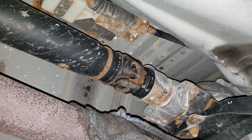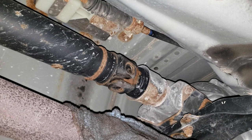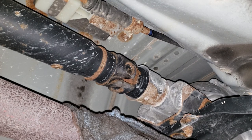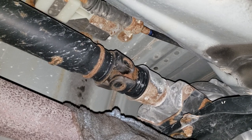We are obviously looking at the other end of our drive shaft. The most important step here is to make sure you don't get all kinds of oil falling onto your exhaust because it will burn off and drive you and your customer a little bit crazy. It'll probably run off that rag onto the floor, so place a drain bucket in the appropriate position. The last time I did one of these was with my buddy Christian — I still missed the drain pan and got the floor. So make sure you place it appropriately. Go ahead and ease your shaft out nice and slow — you've got to get it up just a bit so that you can slip it past the diff.